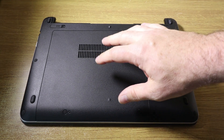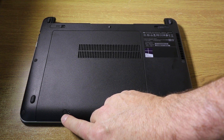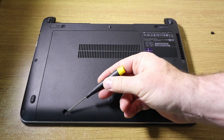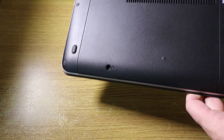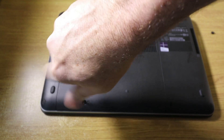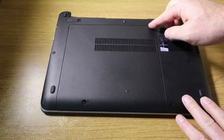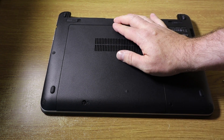Now our disk and the memory is under this plate here and to get this off we need to remove the little plastic cover and then in there is just a very small Phillips screw. Now that actually won't come out so that will stay in there, you don't have to worry about unscrewing it too far — that will actually stay in there. Then all we do is basically just prise this down, which can be a bit tricky.